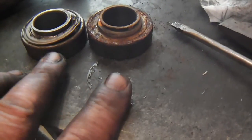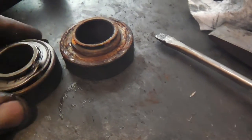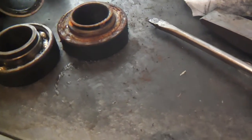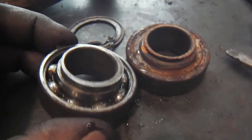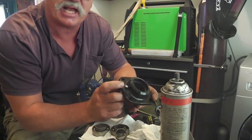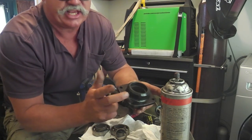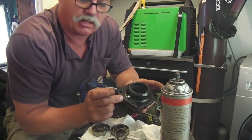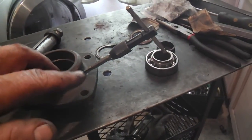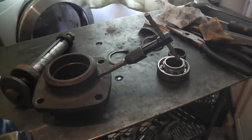And so here are two bearings that just came out of this one. And as you can see, this is the lower bearing where it'll pick up that moisture. This is the upper one, and I plucked the seal out of it. And even though they might look pretty cruddy on top of the seal, underneath in the bearings they can look pretty good. And a zerk fitting in here, and just for your information, these are cast iron or steel, and that's no problem in drilling and tapping. So yeah, piece of cake, just threading right through there, and no sweat.